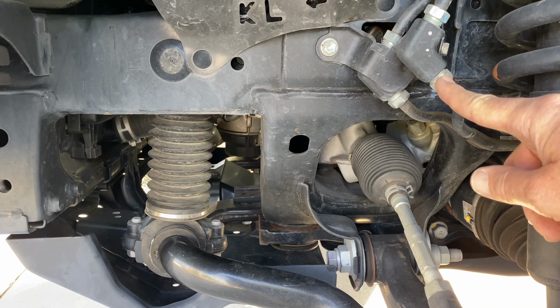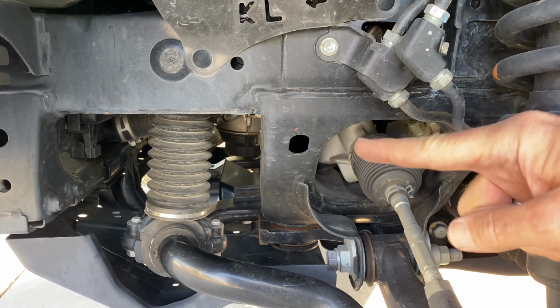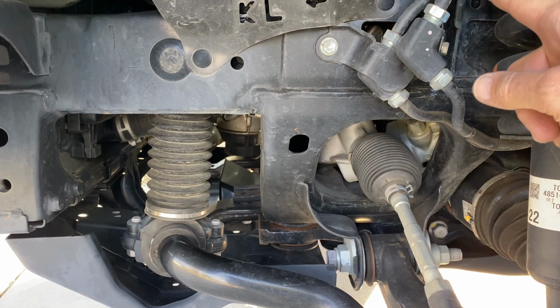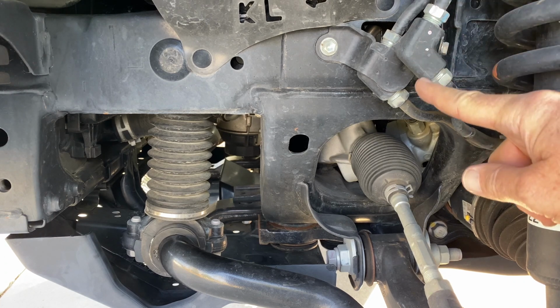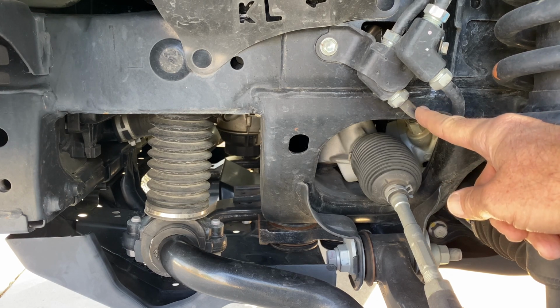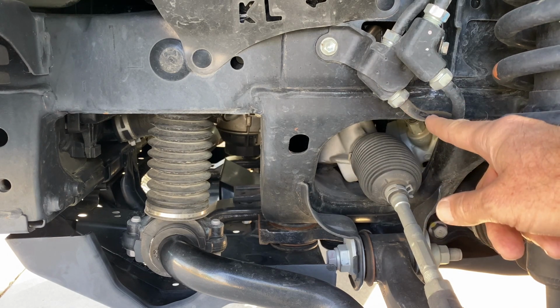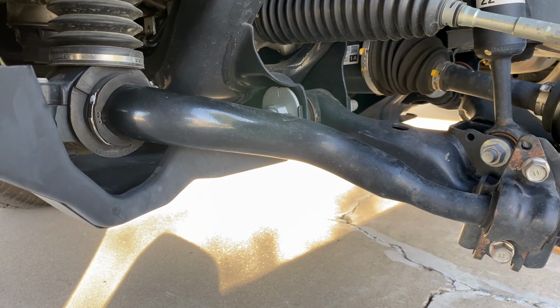These are hydraulic lines that are connected to the KDSS cylinder. The cylinder has a piston halfway up its length, and the oil chamber on the upper side of the piston goes to one of these lines, and the oil chamber that's below the piston feeds to the other line. So in that way, if the piston moves up and down, oil will flow in these two lines. And that is part of the reason why KDSS can work.